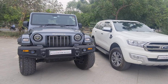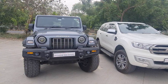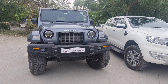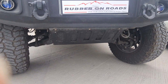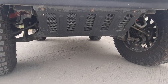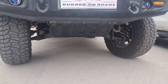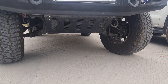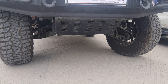Now we've seen the side proportions. Let's understand what difference came from underneath, because ground clearance is very important. The ground clearance at the lower suspension arms was previously around nine inches from the ground, and now it is a massive fourteen inches. So the car has almost been lifted by five inches from the ground, which is a combination of both the tyres and the suspension lift kit.